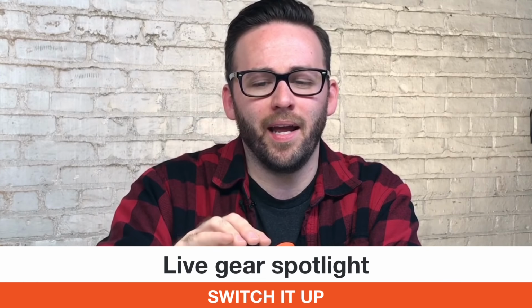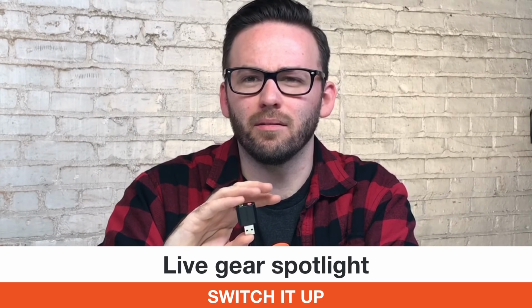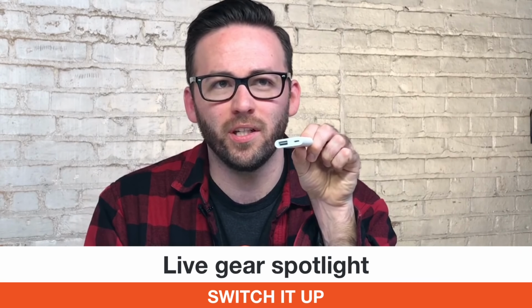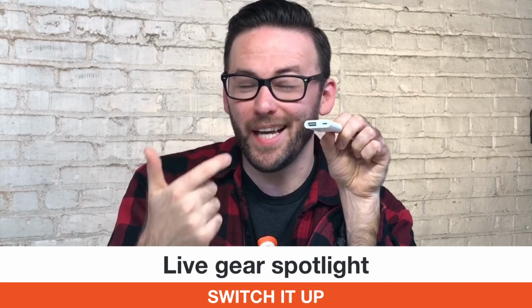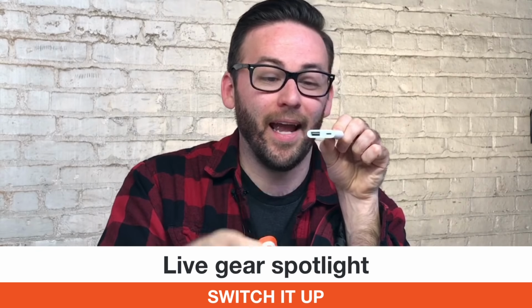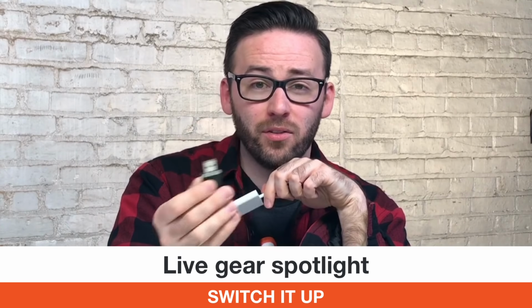That will also work with the new iPads, correct? With the USB-C? So there's a new, this will work. If you have the new iPad and you get the USB-C AV multi-port adapter, that does have USB, HDMI, and Lightning plugs on it, right? So you've got those 3 plugs, whereas something like this is just Lightning to charge it and USB. Well, if you've got the USB-C AV multi-port adapter that works with the iPads, you can get the USB-C input and an HDMI, and this would work with the USB-C to USB connector. So this is another option to go into your new iPads.